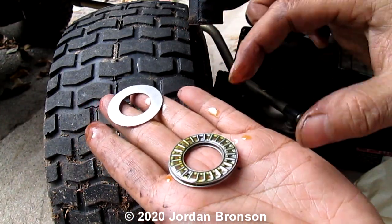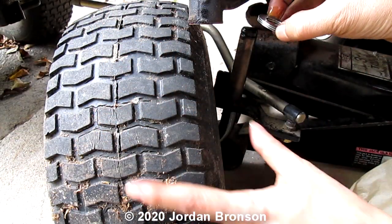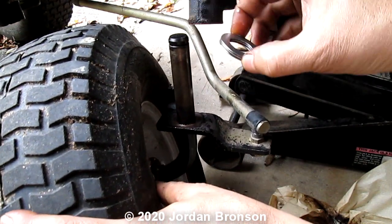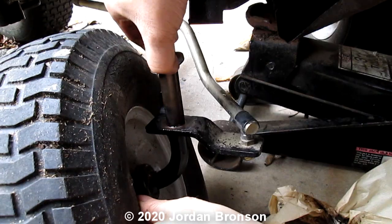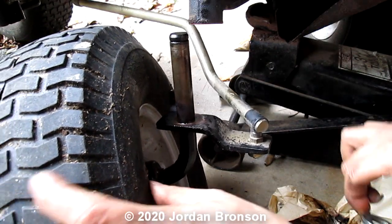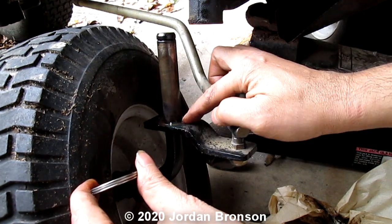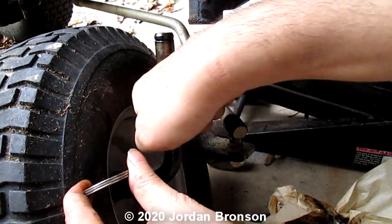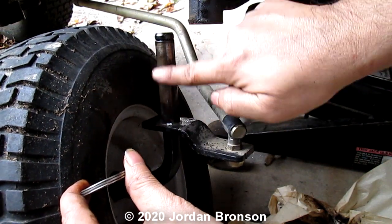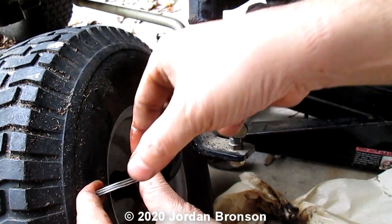And that's it. Put it back on, slide it over to your shaft right here. And let me look down there a little bit, right down there too, while I'm at it. Just put a generous amount. You can use gear oil, you can use whatever, but I like gear oil because it's a lot thinner. And then the grease, don't forget, we're going to grease that later.